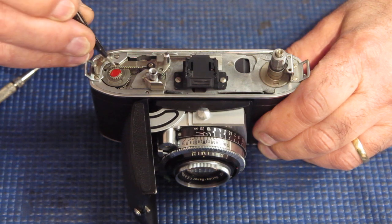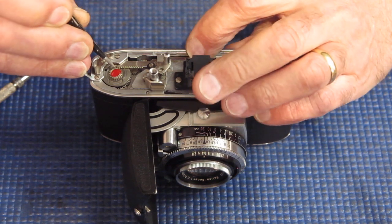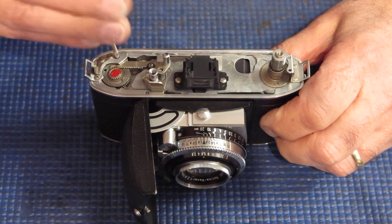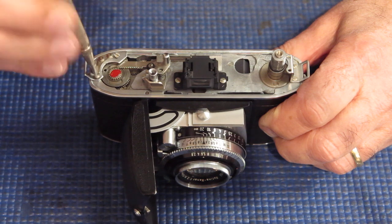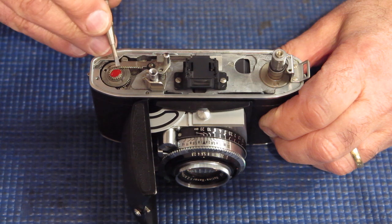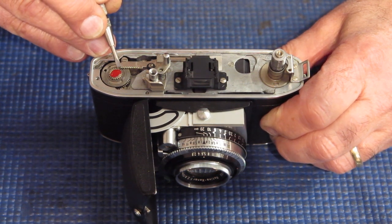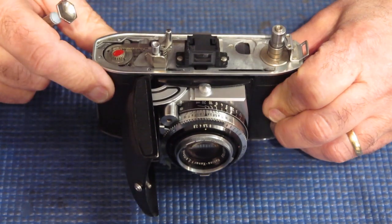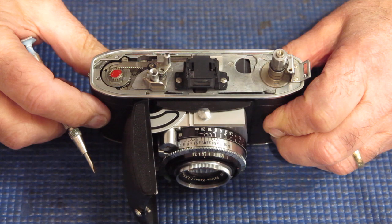The cocking rack here is just touching the gear at this end, and the screw here is loose — so someone's had that off. That rack is not connecting with that gear correctly at all. The tooth on this gear is damaged, bent out of shape — so that gear is damaged. The rack looks damaged too: it looks swept out in the middle, like the teeth have been worn at that point.